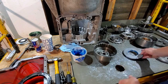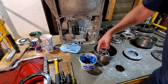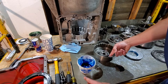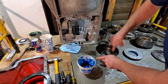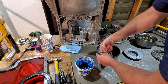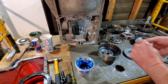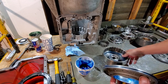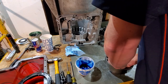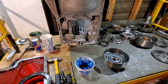We're getting a little low on assembly lube but should have enough for this build. Even though we went around the piston outside and inside with it, I still like to do the drum portion as well, just for added measure. Since this is a square cut seal, you do not need a lip seal tool or feeler gauge. It literally just goes in — give her a nice firm push and now you're in.